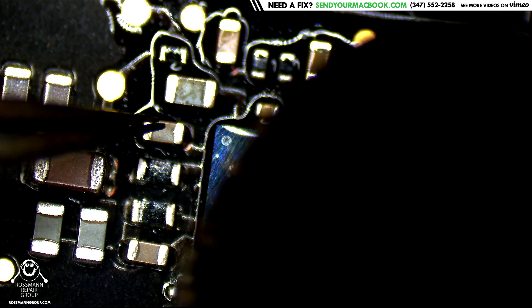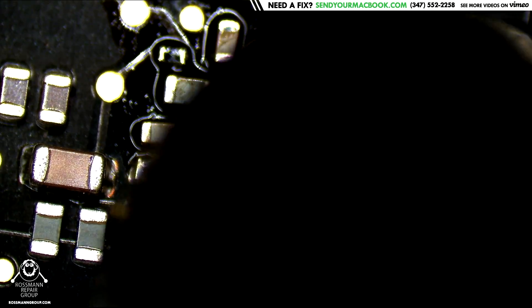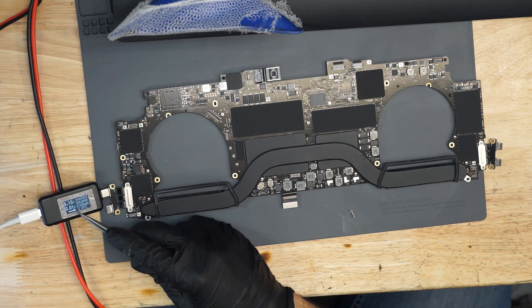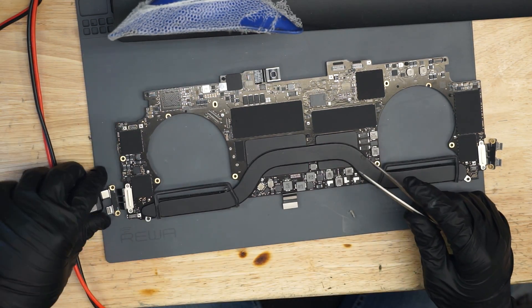It's a chip that is regularly required if you want to do repairs on these machines. There's no change — it's taking the exact same amount of power it was before, and it's stuck at 20 milliamps because we don't have PP3V3_G3HOT, which, just as with all the older machines — the A1707s, A1708s, A1706s — is required for the USB-C port controller to speak to the charger and tell the charger to put out 20 volts rather than 5 volts. It's only putting out 5 volts because it's not able to communicate with the machine.